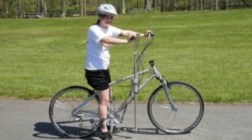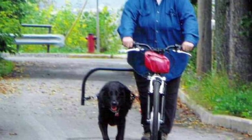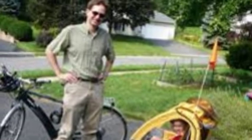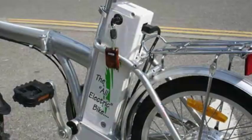I've tried to rate my e-bike kit very fairly in terms of power and range. Many other e-bike kits list their maximum range value as what they get when the rider is pedaling as well, and usually at a reduced speed. This is how many kits get those 30-mile range figures. My kit is rated at full range, top speed, highest power draw, and with no pedaling, where it gets about 20 miles. If the user pedals as well, 40 miles is achievable easily, and if the speed is reduced just a bit, 60 miles is achievable. But these are just number games when it comes to marketing, which is why I've tried to rate my kit as fairly as possible.